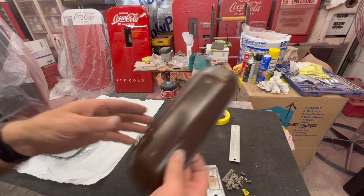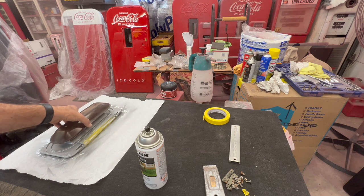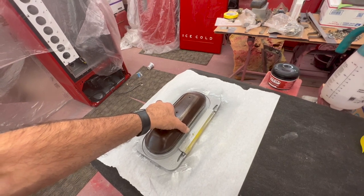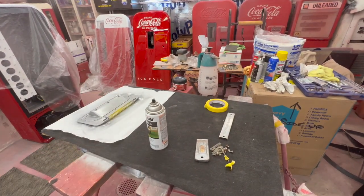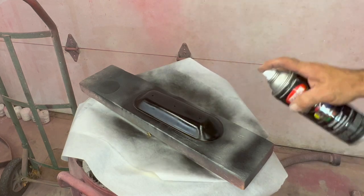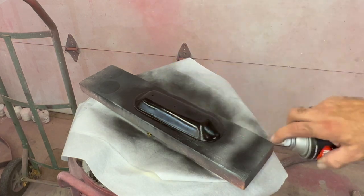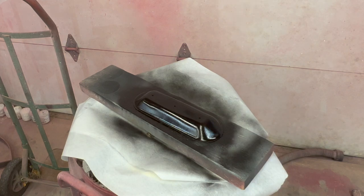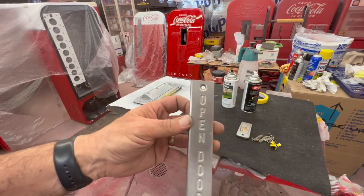The hammered effect is actually better if you don't put it on heavy — it gives just a little bit of a light crinkle that way, giving it that nice hammered look. While we're doing that, I always paint these black to clean them up a little bit. This is the interior piece that will go over the gasket. Once you put your gasket down, that will go on top of it as a sealing area. Shoot this with a little black — this does not need a lot of paint. Just really light coats — all you need. It really cleans it up and makes it look brand new. Get your edges — they will show up if you don't.